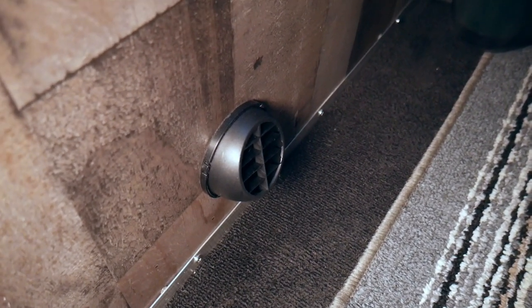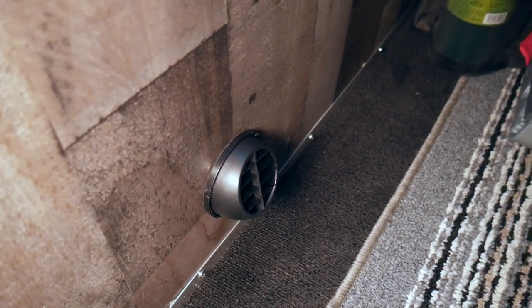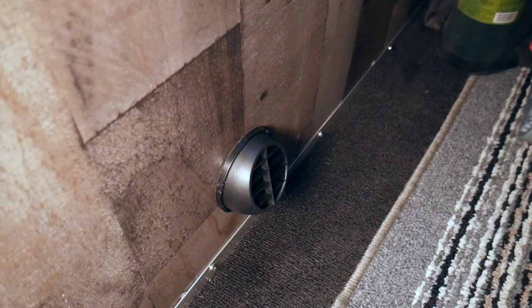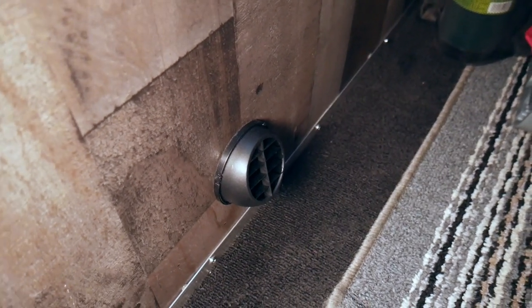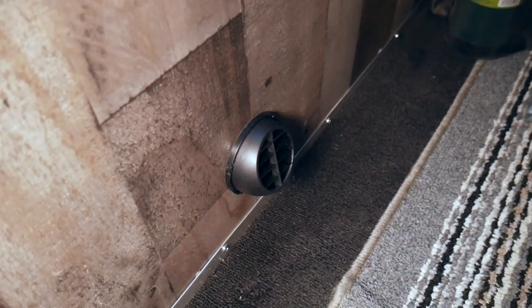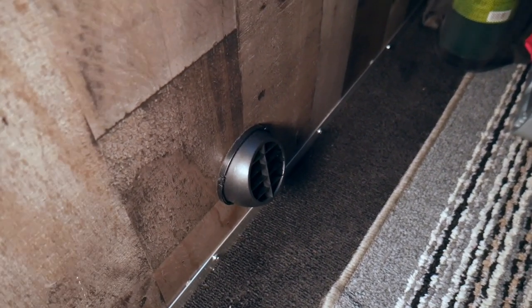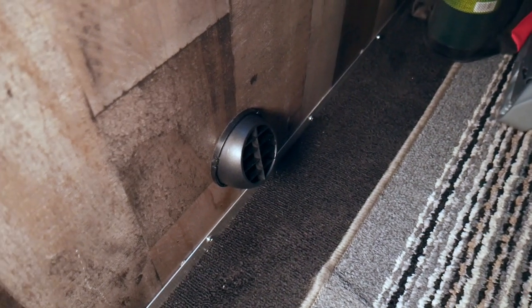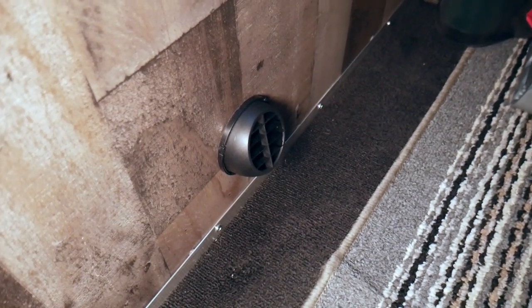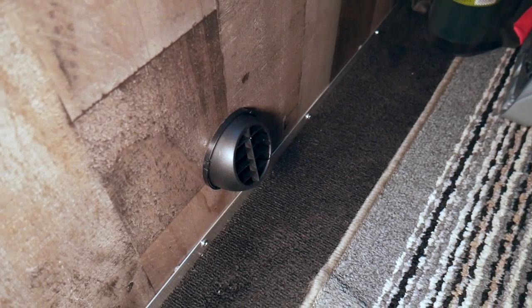This is my sleeping platform looking at it from the inside. As you can see, I mounted the actual diesel heater unit underneath it in an area where I could easily route the hot air duct out to the area I need to heat. It took a little time to figure out because underneath the truck you have limited options on where to drill the hole — you have the fuel tank, spare tire, and other things to be mindful of. It took some measuring and brainstorming to find the right spot.